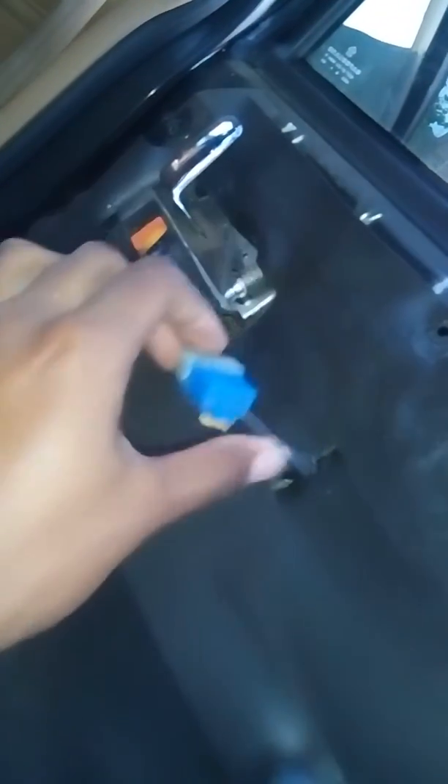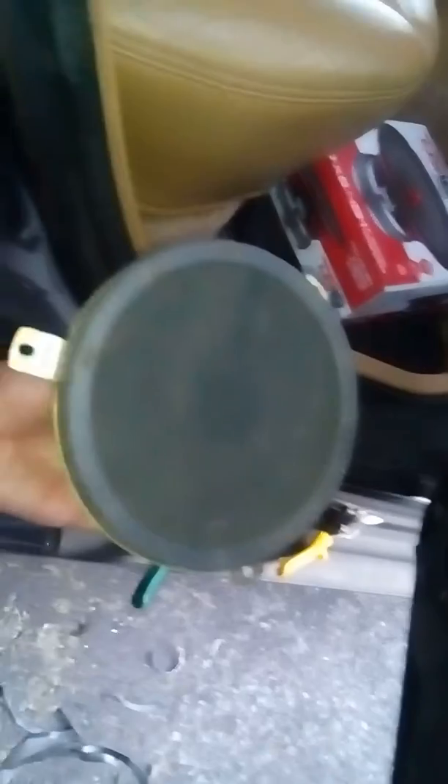When you get to your door, pop these clips off — I have roughly 12 clips around the door. Pop them all, don't be scared. Disconnect this connector; it's your electronic control for your window to move up and down, your power locks that connect to your body control module. Then unscrew the speakers — there are three screws holding the stock speaker in.